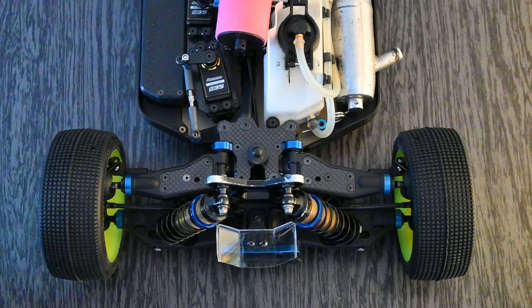How to tune your car's toe angles, both in the front and the rear — you sort of have to try it on the track. It's really hard to guess how it could be or look at it on the table. You really have to try it on the track, see how it feels, and determine from there. To conclude: I would not focus on the front toe too much. I would have a few degrees — maybe one or two degrees of toe-out — and focus on other things in the steering geometry. One or two degrees is a very good starting point and you'll most likely be very well off with just that.